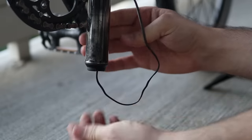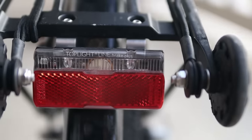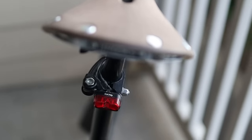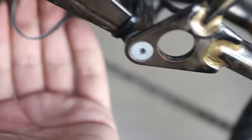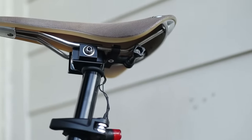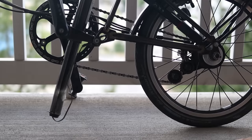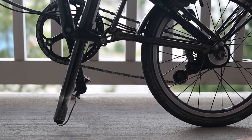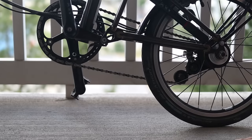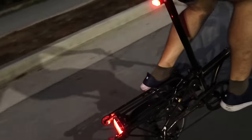You may be curious why I have a wire running across the seatpost. Both my front and rear lights are powered by my dynamo hub, and I decided to install a second rear light closer to the saddle. It's connected to the main rear light in parallel, and the cable runs from underneath the bike, up the seatpost and into the rear light. I attach the second light to the telescopic seatpost clamp using a zip tie. The whole system doesn't affect the folding process because I keep enough slack on the cables. I can make a more detailed video about this mod — leave a comment if that interests you.